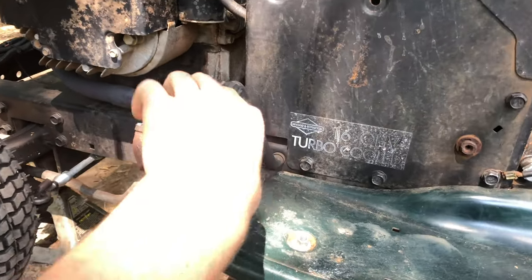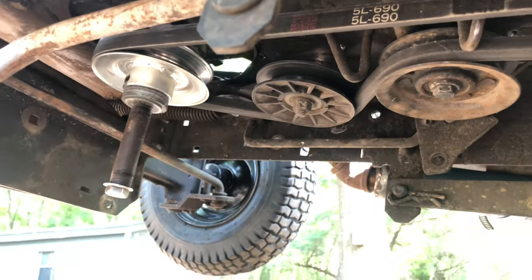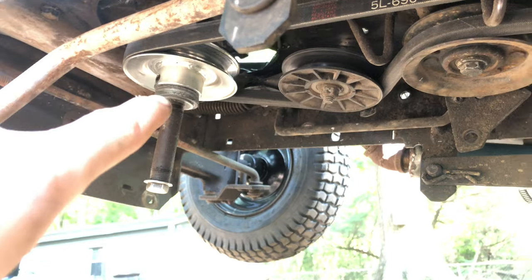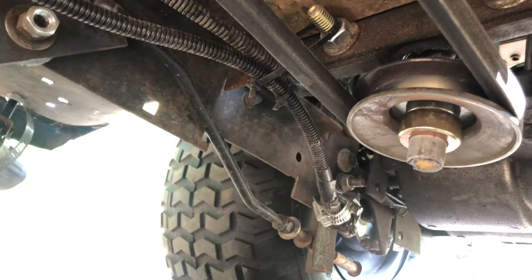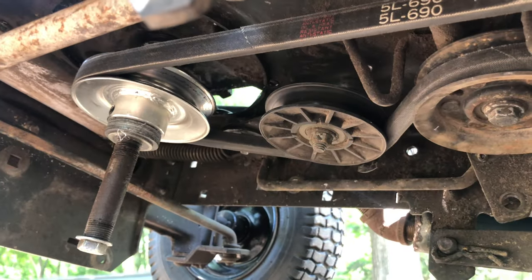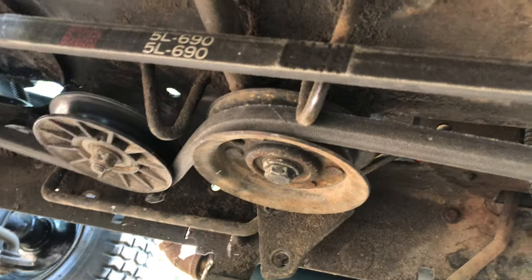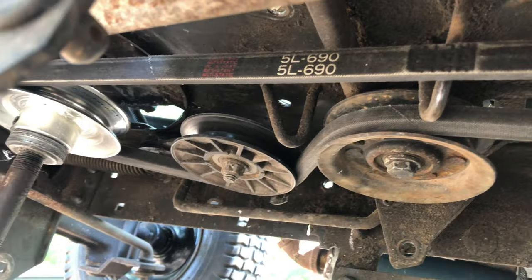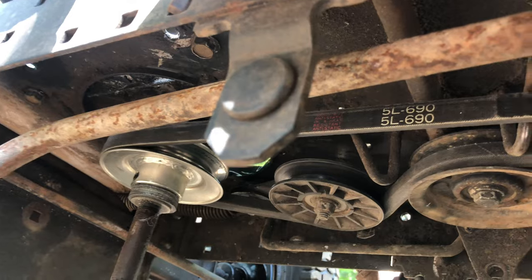On the underside, the clutch configuration of the pulleys is completely stock. There's a four-inch pulley up front running back to the jackshaft, which has a three-and-a-half-inch pulley. The belt on this thing is actually a 5/8 belt — believe it or not. You can actually fit a 5/8 belt on these Craftsman AYP chassis; just make sure the belt fits in the pulleys well.